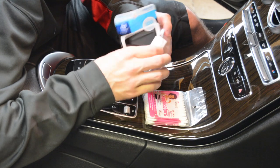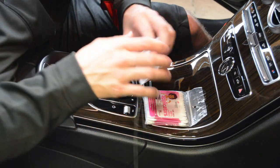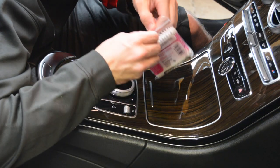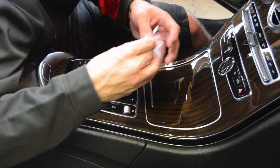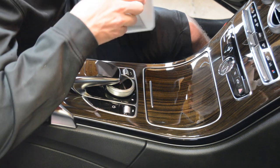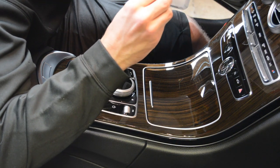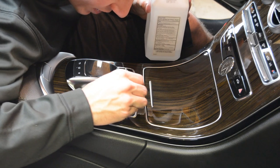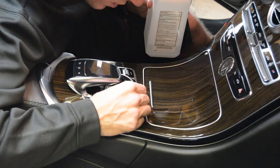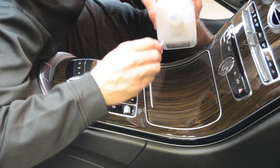Just make a quick video on it and see if I can make this happen. So we'll take floss and go down in between it. Let's go ahead and get it a little bit wet with the q-tips. I'll probably just do one q-tip. I'm not going to overly saturate the buttons. Some people have talked about spraying cleaners down in it and soaking the area around the buttons with cleaner and letting it get down in there. I'm purely just trying to get a little bit of alcohol in between these buttons, and get down in there, work it down in there, and then we'll get after it with the floss here.